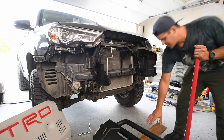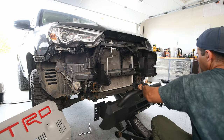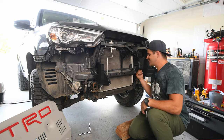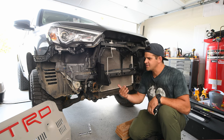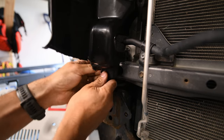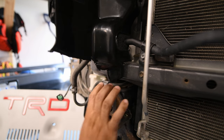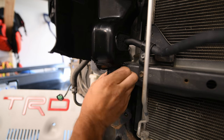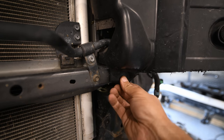I have a jack with a piece of wood on the bottom so I don't scratch the metal — you don't want metal-on-metal contact. After the test fit, it was contacting the air deflector on both the passenger and driver's sides. I'm going to cut off about three to four inches on the bottom of each air deflector to give enough space to install the bumper. When trimming, make sure you keep the clip piece that goes into the slot at the bottom intact as a support for the frame, while removing the plastic that would contact the bumper.